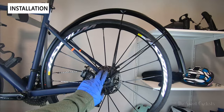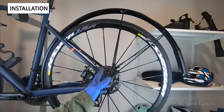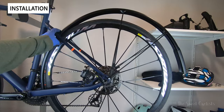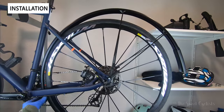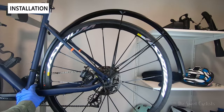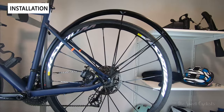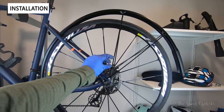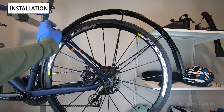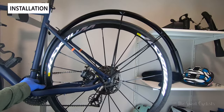There are four attachment points on the rear: eyelets on each side, designed to work with a variety of bikes — that's why the struts are so long. There's also an attachment point at the top that can be flipped horizontal or vertical, and another at the bottom near the bottom bracket to push it back. You'll want to adjust the struts first — in my case I need to cut off almost an inch on each side, then re-measure to get a more even gap.